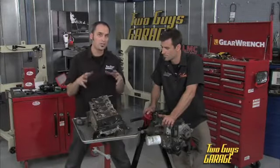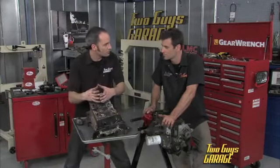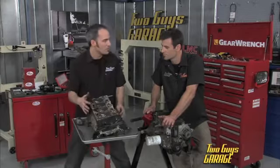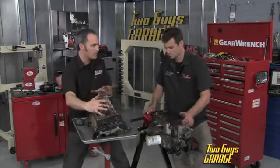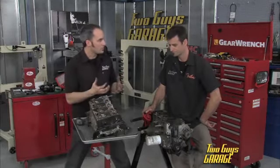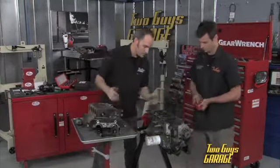So if you overheat it too much, you can lose a lot of rigidity to hold in these valve seat inserts. You can start to develop cracks a lot prematurely. So overheating an engine's really bad. You can fix it. A lot of times you'll get a warpage in the head, maybe the block. You can skim cut them, but you could lose a lot of strength that will kind of eat you over time. Let's take a look at this head gasket.